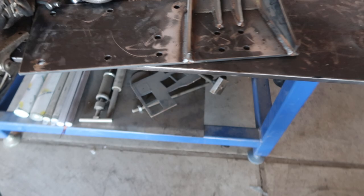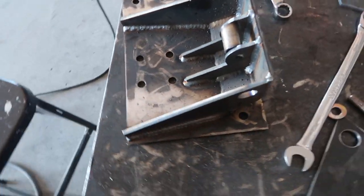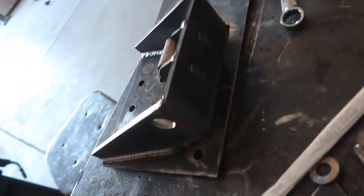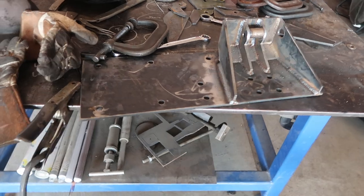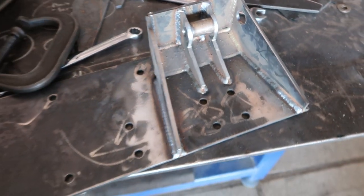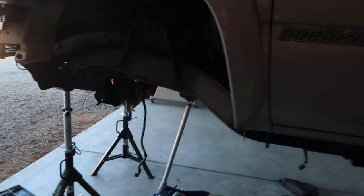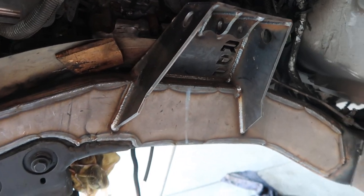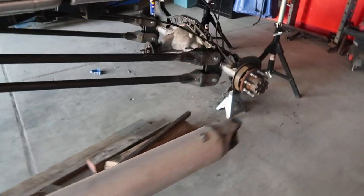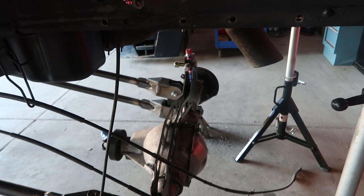We have one of the shock towers done for the rear. We're gonna go mock this up, get it bolted to the frame, get it all set up, and see how it looks — we should be solid. Obviously it needs to be blasted and powder coated, but we're just building right now. I still have the other side and the front to do. We'll get the other one on there and start figuring out the back — some sort of cross member for the panhard bar — and maybe get the back close to done today.